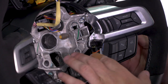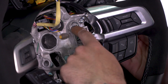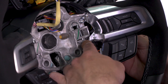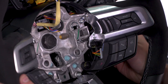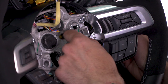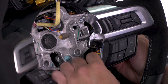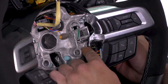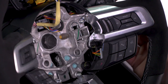So what I mean by the retainer clip going in from the small hole on the side of the airbag, as you can see on both sides here, there is this U-shaped clip. Now this retainer pin, that's actually where the hex key is going in on the side. So when you put that hex key in, you're pressing this side of the clip in, you're gonna snap the airbag into place and then let it go, and that'll hold it in on each side. So for here, push it in and it might go straight past like I just did. So you're gonna wanna line that up and go in and a little bit lower to snap onto this. From here, you can go in, click it into place, and repeat for the other side.